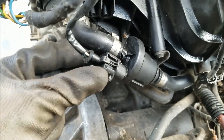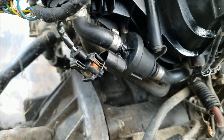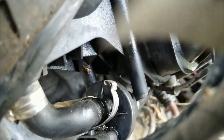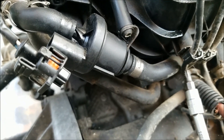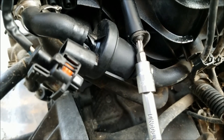I'm going to undo this connector first — just press on the plastic tab. Now I'm going to undo this hose clamp right here. They are tricky to remove; I'm going to stick my screwdriver into it and pull it upwards. There it is. Now since these clamps are turned in the wrong way, I'm going to use my T25 Torx bit to undo these two screws.